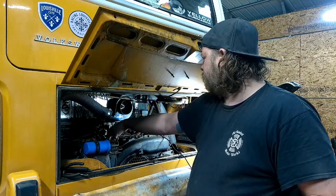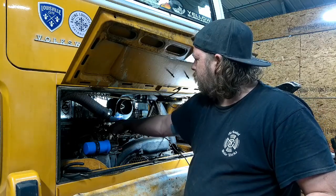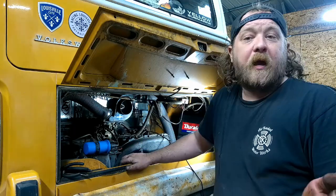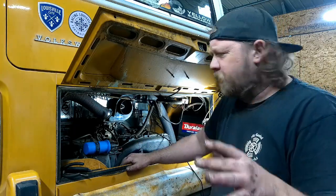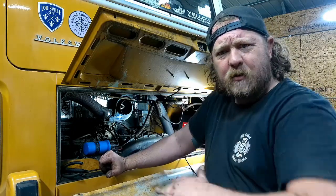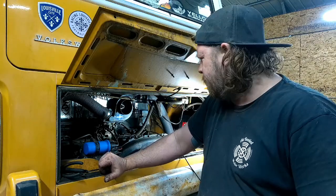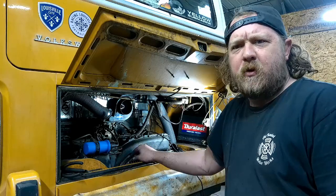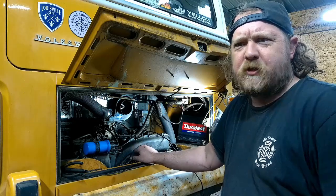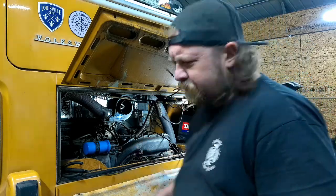What I'll do now is fire this thing up, just checking my routing. Gonna fire this up and see if that timing mark moves. I think we were at 16. I want to see it closer to the 7 mark, I'll take 9. Let's see if the valves and the points were worn and it shall go in. I'm hoping to see it move. Otherwise, everything was probably adjusted correctly and we just did this for whatever. It should move. Stay tuned.